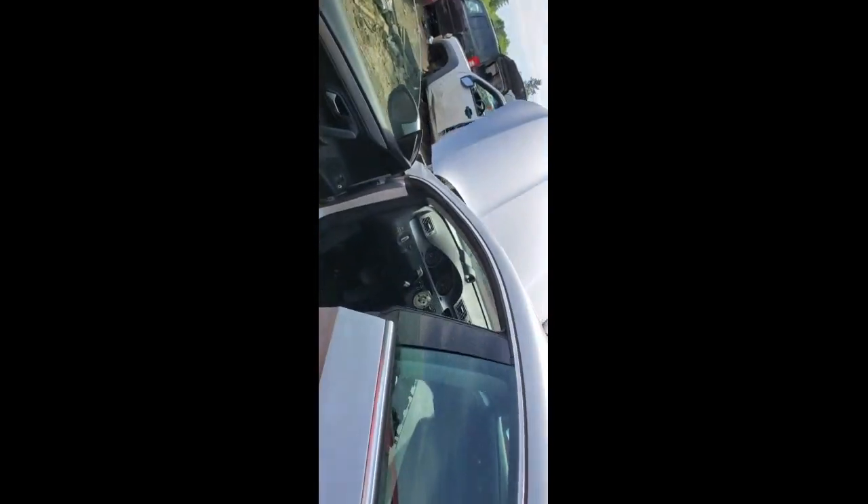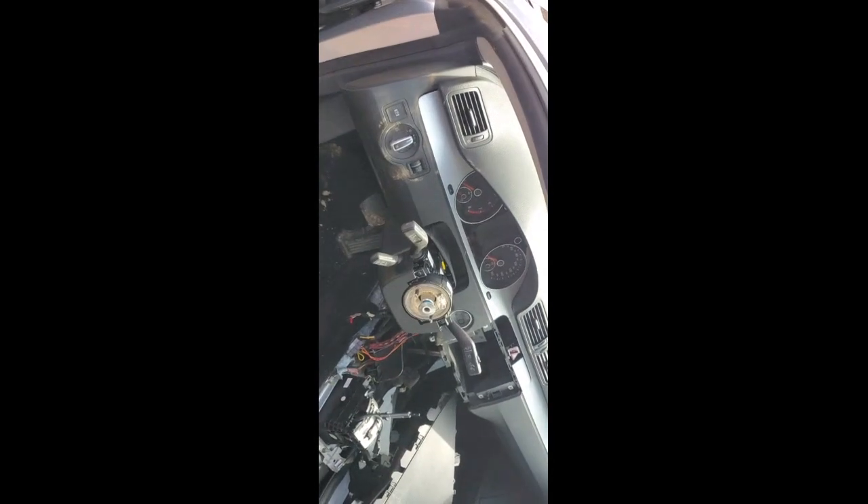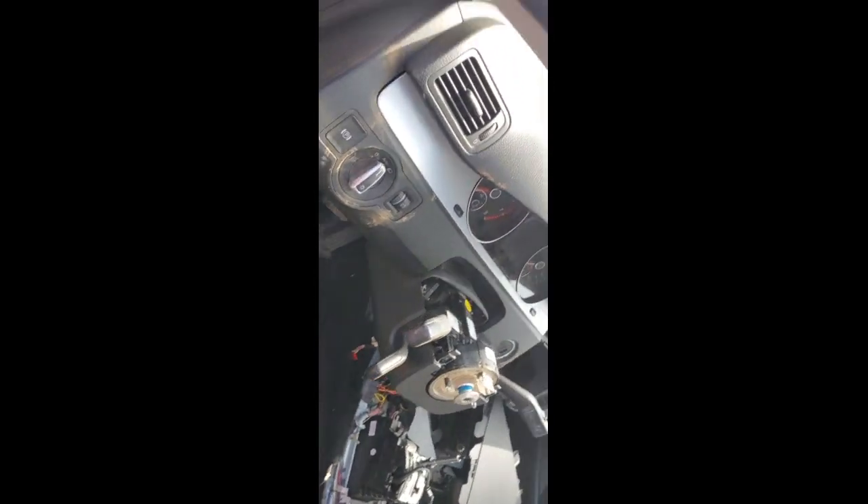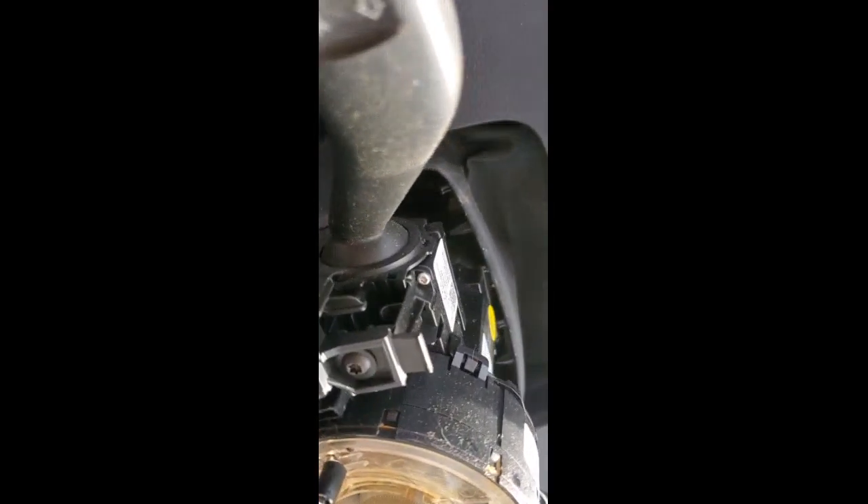The Audi and the Volkswagen are interchangeable. I'm not really sure about BMW — could go over and pull one off to see. But here's the CC that I pulled the steering wheel from. Someone already got the seats — they were really nice. Same spline right there. That is the clock spring. Maybe if I look into it further I might be able to use the clock spring from the CC into the Volkswagen, but I'm not really sure what's all involved. It's pretty big and has all the controls, so it probably would not work.